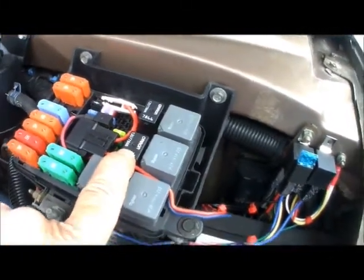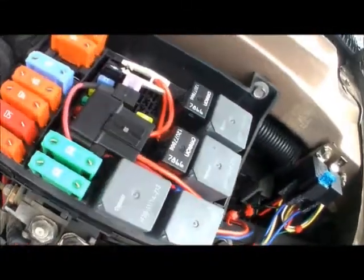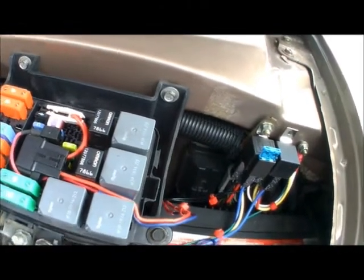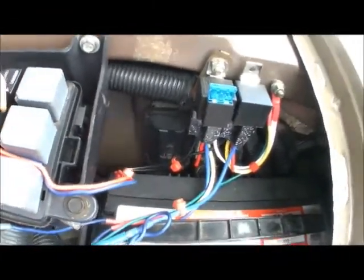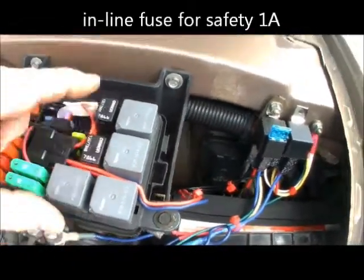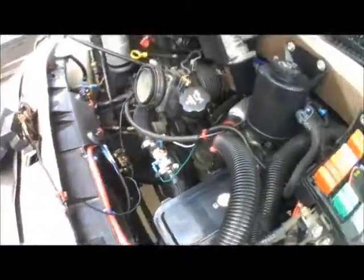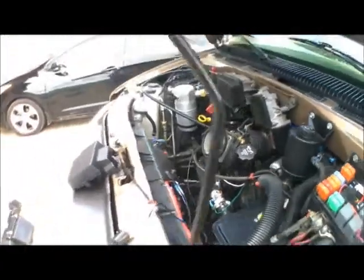This relay right here is the air conditioning activation relay. If you look really close down in there, you can see right there is a pin. That pin gets hot when it calls for the air conditioning compressor to run. So what I did is I pulled this relay, tucked a piece of wire down in there, and then just plugged it back in. That wire goes over to the coil of these relays, so now anytime the compressor turns on, this relay kicks in, goes to ground, and my electric fans turn on. Really quite simple, and it works very, very well. Thanks for watching.